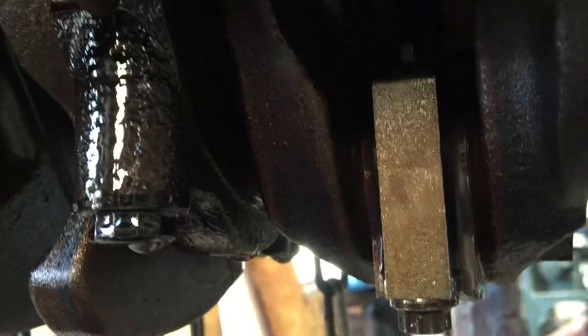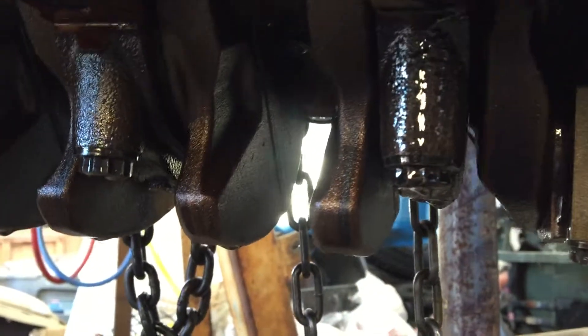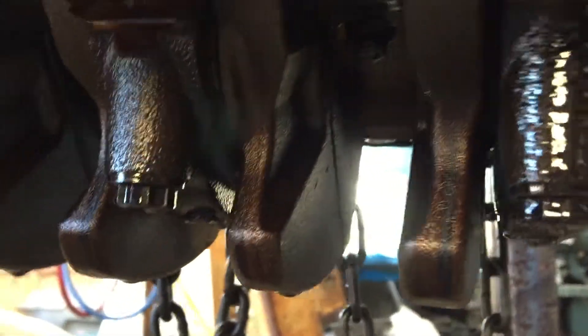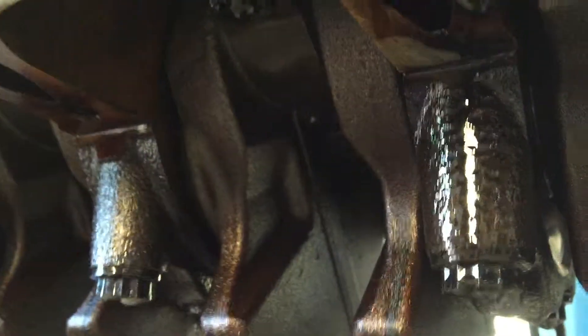It's very dark under here — see how dark all that is? That's how hot the oil got down here. It's pretty much the only place where oil was potentially getting to. It was basically a quart and a half left in the pan, and it's still this dark after I put four more quarts in it.